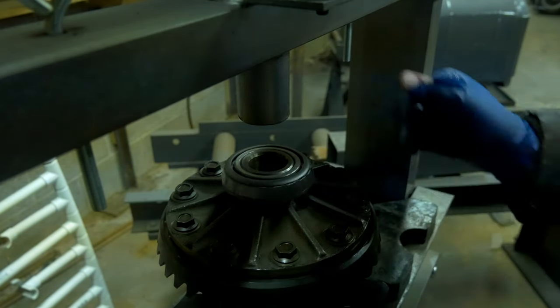These tools and other machinist tools like them do, so you can trust the results that these things are putting out. The first tool you're gonna need, an inch pound torque wrench. Now I use the dial type just because I like it. If you want to cheap out a little bit, you can still get a decent reading, and you can use a beam type, and I'll leave links in the description below for all of these tools, but you can use the beam type inch pound wrench. This is to measure the bearing preload to make sure you're within spec in inch pounds.